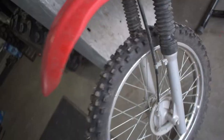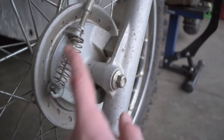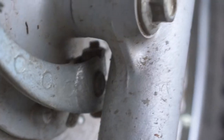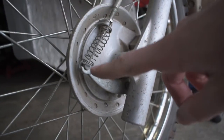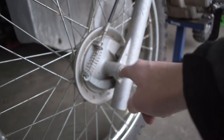The next thing is this little pivot arm here on the front of the hub. This is where it pivots as you pull the brake — this arm actuates and can get stuck and sticky. The arm can also be improperly set. On the end of the arm there's a piece with a whole bunch of teeth, like a shifter, and you can adjust the pitch by pulling it off, rotating it one position, and sliding it back on. If improperly adjusted it could be overextending and jamming the piece inside.